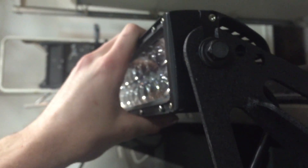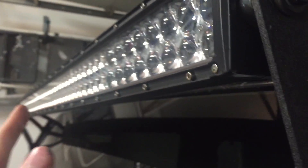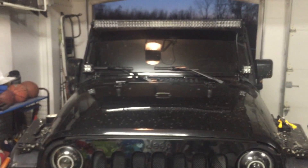The other side is already just a little bit tightened — I just tightened it up just to hold it in place because I'm videoing with one hand. You'll have your wire here that leads down to your harness, I will mess with that here in a second. Make sure you have the bolt in already before you put the light bar up here. It usually helps to have two people, one on each end — I did not at this point so I just set it on one end and connected it here. Just tighten both bolts up, make sure it's kind of aligned where you want it, probably kind of downward-ish. I think it looks pretty good right now. Nothing's wired up just yet, you can see the wires here are still on the ground. But that's how you kind of place it on there.